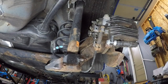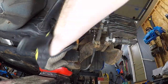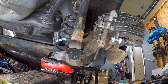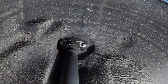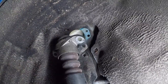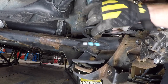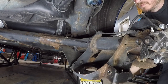I'm starting with the rear of the car and first I'm going to remove the lower shock bolt. I'll loosen it up but before I drop it down and pull it out I'm going to support it with a jack, then do the same on the other side, and then I'll be able to lower the entire rear suspension. Then I'm going to move up to the upper shock mount and remove the two bolts that hold that in place. Once that's removed we can go ahead and pull out the rear spring. Since the rear of this Beetle is not an independent suspension, you're going to have to do both sides simultaneously and support both sides with a jack.